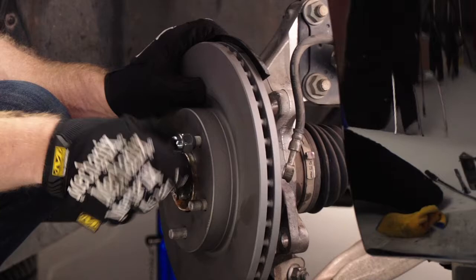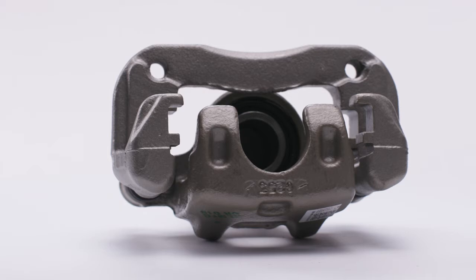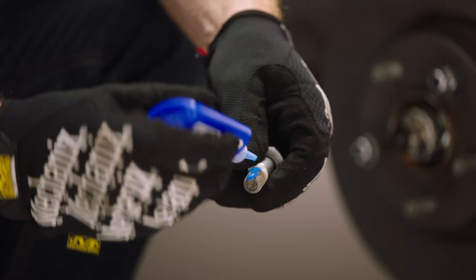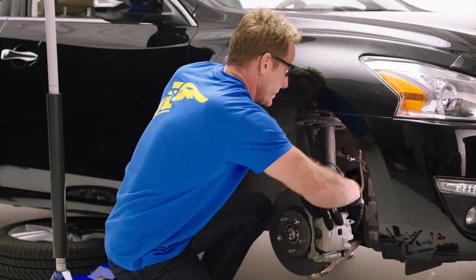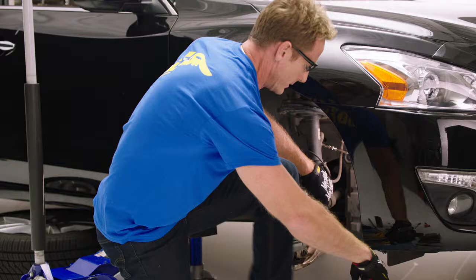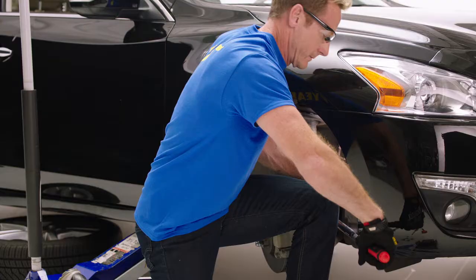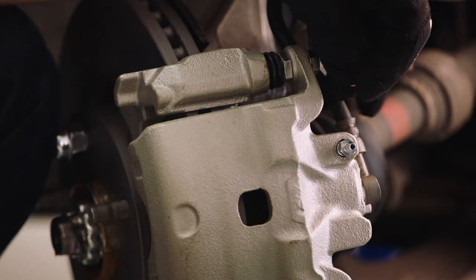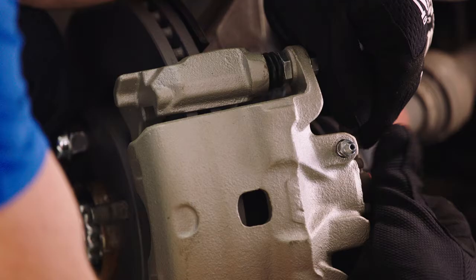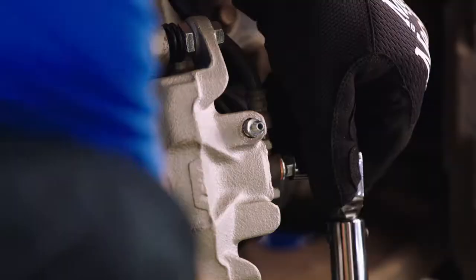Step four. At this time, we're going to install the new Goodyear caliper, which has an amazing proprietary coating called Antiox Max to protect against rust and corrosion. Let's take the bolts and clean and coat them with a good thread locker. This gives us a good tight fit. Now we mount the new caliper in place and replace our top and bottom bolts. Then we'll snug up both bolts with a ratchet. Then using our torque wrench, torque the bolts to the proper spec for your vehicle. Be sure to reference the brake torque specification guide when doing this final tightening. Now we must reattach our brake line to the new caliper. We must install the new banjo bolt and new copper washers into place. Make sure there are no old washers left behind. The washers prevent leaks in the brake line, so make sure the banjo bolt is tightened to the correct torque specs.